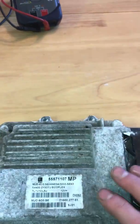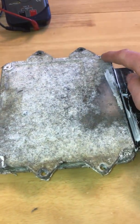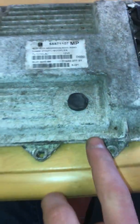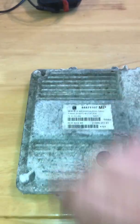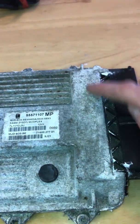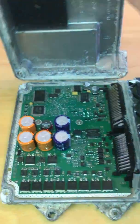So, obviously you get the ECU off the car. There are some bolts, little screws, which I've already taken out — either corner and one up there as well. Loosen them off. Now it won't come apart straight away — it does have sealant running the entire way on the inside of the cases and up over here. These back and side edges came away quite easily. It was this front section here that I had trouble with — all I did was heat it up around here, prying it slowly, and it came off.